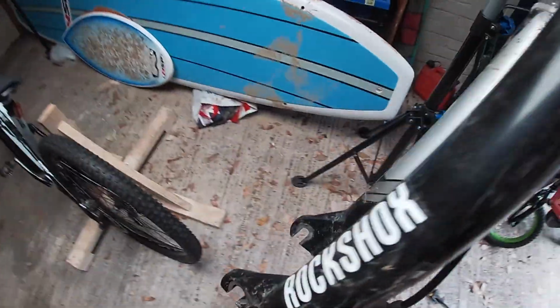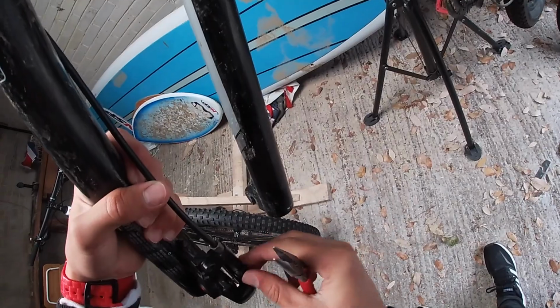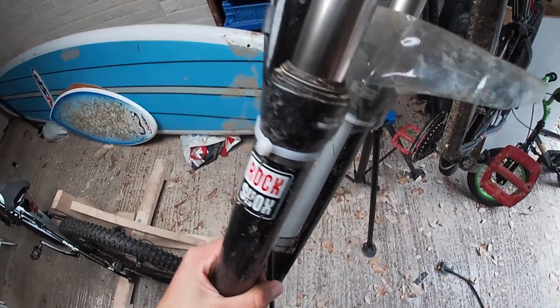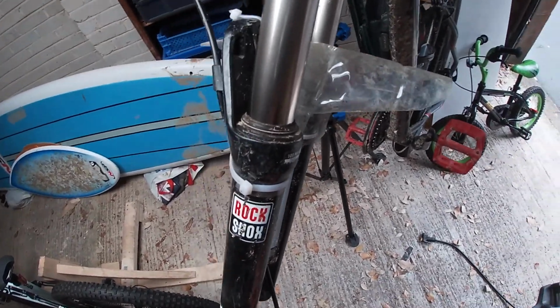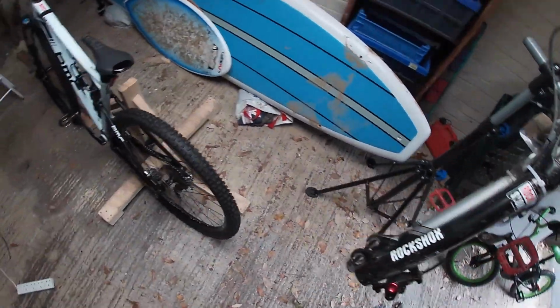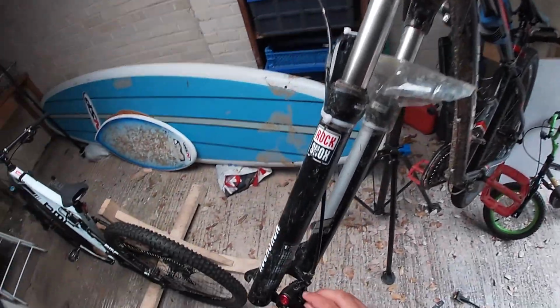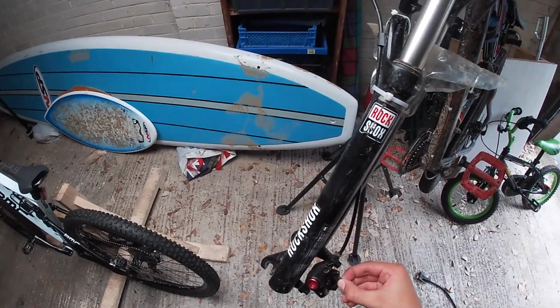so it can be pulled out. Got to pull it out. I should have ordered a new one of these things, but I just couldn't find any pads that fitted my bike which also came with one of these. Grab it out, put it in a safe place, preferably without any oil. Just try and keep all the contamination out. So all you do is take it from the top and pull your brake pads out.